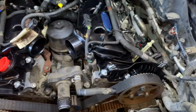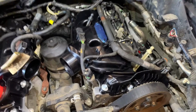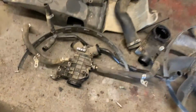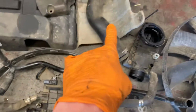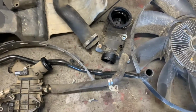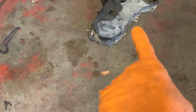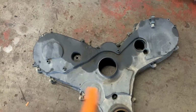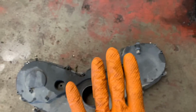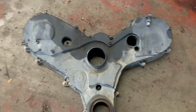So yeah, if we're doing just the inlets up to now, it's pretty straightforward from here. It's not a great deal of stuff. So you've got this, your EGR pipes both sides, the rest of it's just plastics, boost hosing and your viscous fan really. And obviously if you have taken the cover off for the timing belt, you'll need to put that back on. You may have just pulled it forward slightly, but if not, that needs to go back on. And then you're pretty much job done.